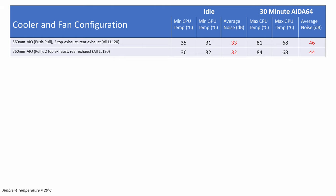When I took three of the fans off the AIO, both the CPU and GPU idled one degree hotter and were one decibel quieter. Under load, the CPU was three degrees hotter and the GPU showed no difference, while that build was two decibels quieter. Those results serve as an important benchmark for what you can achieve in this case — great cooling, though at the expense of some noise.